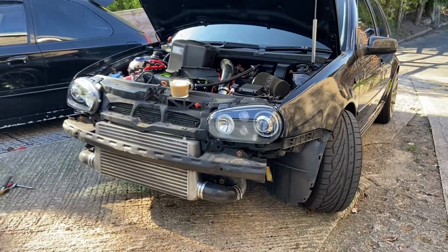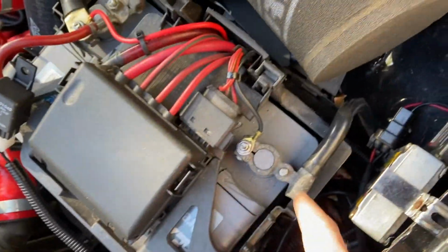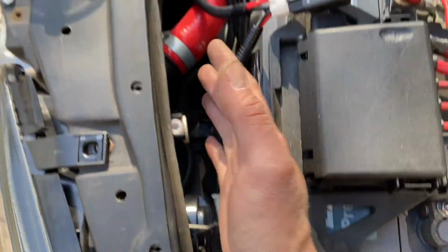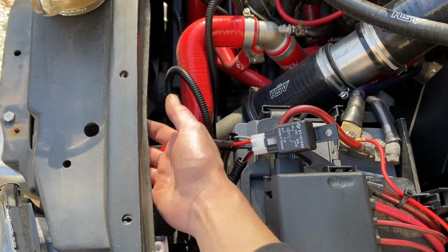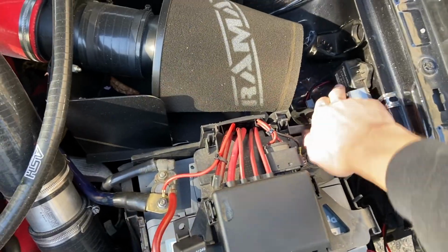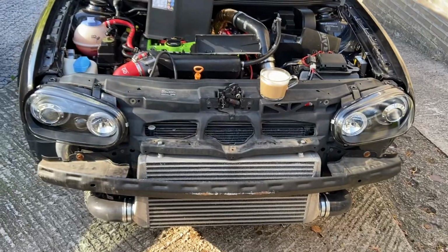Right, in the car, guys, just having a look. Yeah, that looks nice. Really like those. I'll kind of show you what I did with my wiring. So I took that out, got my positive into there, obviously, just cable tied them there, and my negative into there, got them down there, and then they run under there and then round. So what I'm gonna do is put all the relay and everything in here, because it's all empty space in here. Usually there's the air duct or whatever, but my car doesn't have that, so I'm just gonna chuck all that in there. The ballasts, obviously I'm gonna try and get that one in there with the canceller as well, and on that side I've just screwed those in temporary just so they don't go anywhere. I'm gonna have to find a better solution for that, but we'll give it a test, see how it looks.